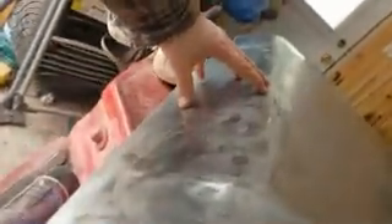Most of this panel — I'm so happy. This panel is beautiful. There's no rust, no corrosion on like 95% of it. There's a tiny little bit of surface rust right here, which I'll treat with the Ospho just to get into the pores and do body work. This is the only spot — just these tiny little scratches. I don't have access to the panel so I can't fix it, but I'll put a bit of putty just right here and here.